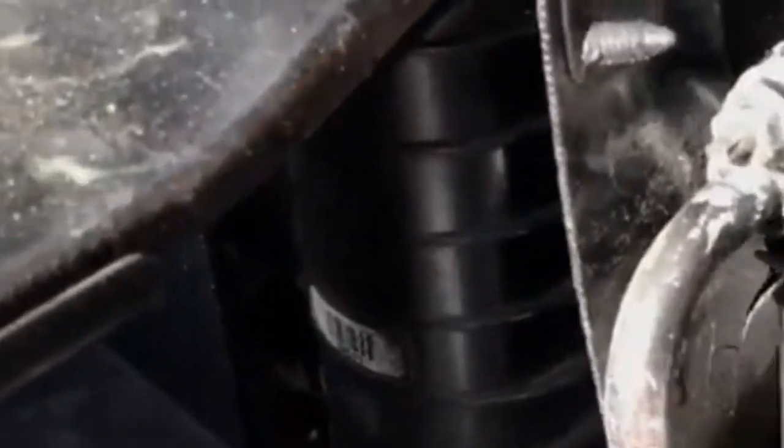So I'll keep on doing whatever I'm doing, tightening these by hand. The 10 millimeter, that's gonna be using impact wrench. And then after that, I'll have to vacuum, the same process that I did in the vacuum video. I recorded that video about a week ago or 2 weeks ago, give or take. You could find it on my channel. And then after finishing up with the vacuuming the condenser for about 13 minutes, give or take.